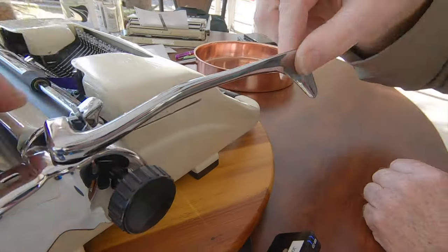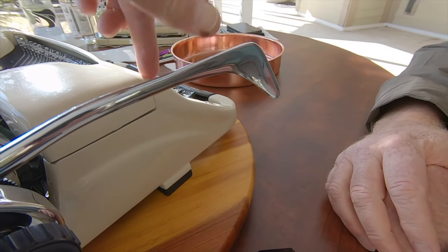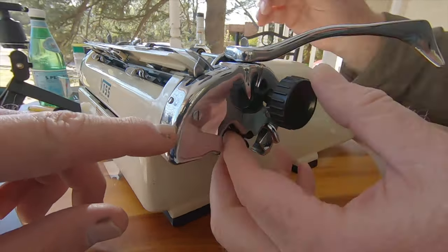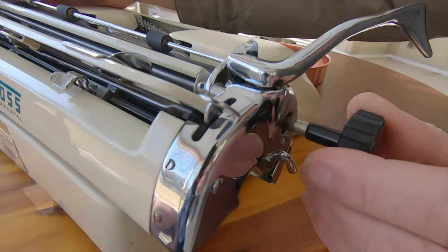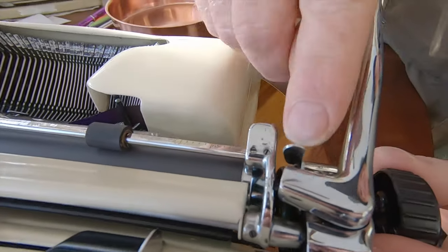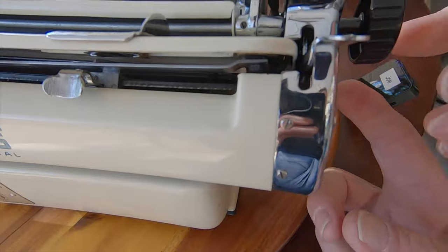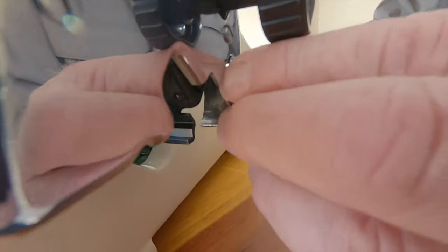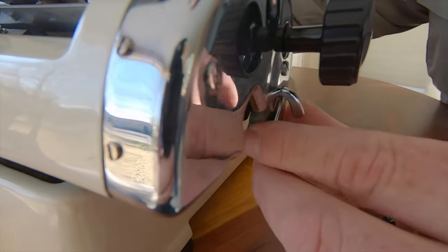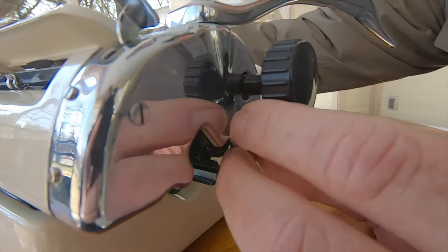On the left side of the carriage you have a carriage return arm — so nicely shaped, really sculpted, beautifully chromed, high-quality machining. You've got your variable clutch that pulls out. Then you have this button here for one, one-and-a-half, or two line spacing. Here's your carriage release lever right there. And there's this really super heavy lever down here for releasing your line adjustment while maintaining your line spacing for ratcheting — a temporary release. So this is not an infinite control; this is your temporary for when you need to do superscript or something different.